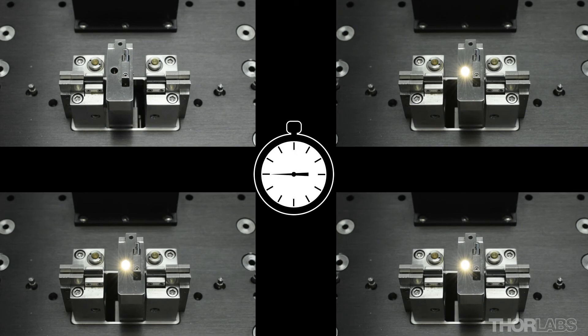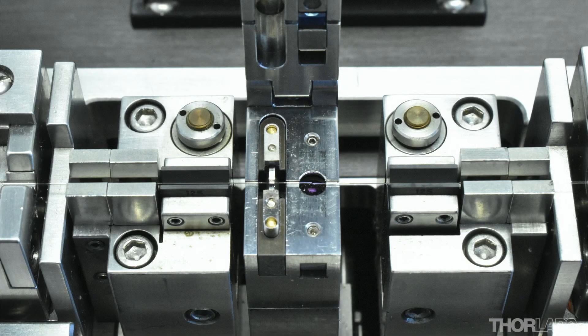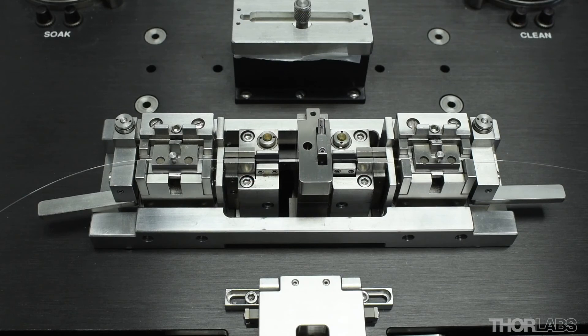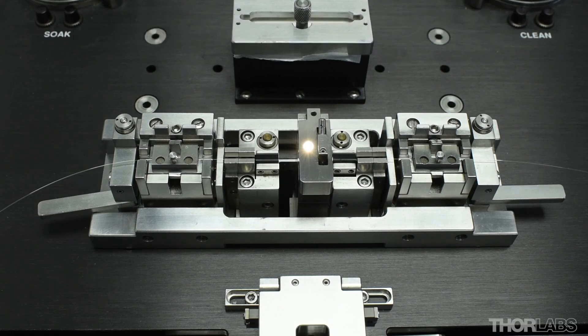This will age the filament to 60 seconds. During the course of the filament's life, its thermal response to the supplied current will vary even though it has been burnt in. It is therefore critical to regularly normalize the filament so that it maintains a consistent power output and heating effect on the fibers.